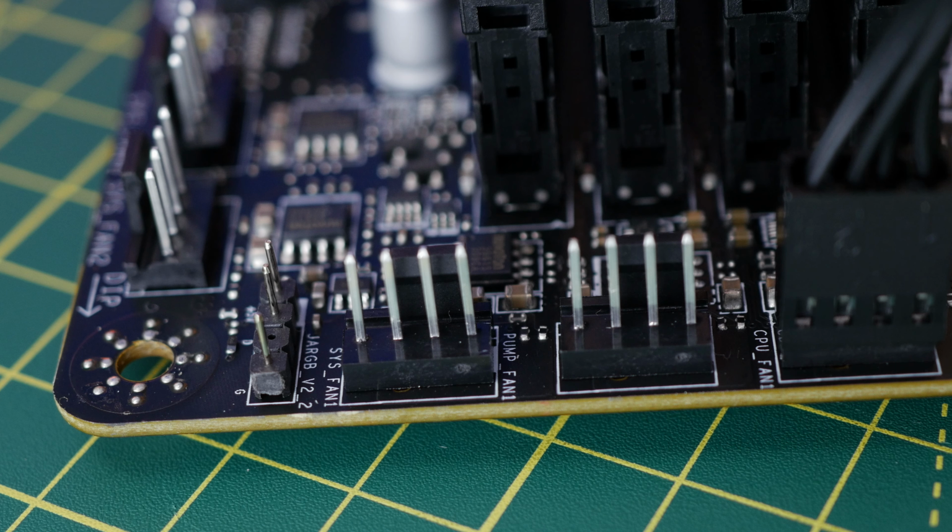This enables you to control the RGB lighting for 6 fans and the power for 9 fans. So you can see this thing has multiple ports on it that you can connect your fans up to. You can use fan splitters, so you can see this triple fan splitter, for example, on each of the fan power ports, which means that you can power up to 9 fans, so just the power, not the RGB, by connecting those up to ports 1, 2, and 3 on here, with splitters on each of those ports, and that takes the place of plugging them into the system fan headers on your motherboard.